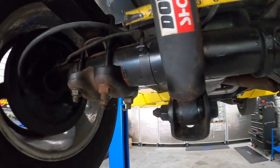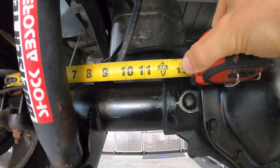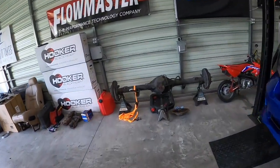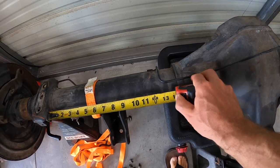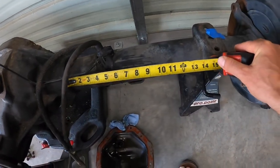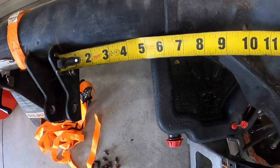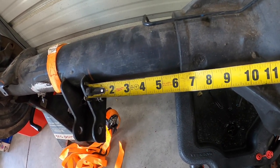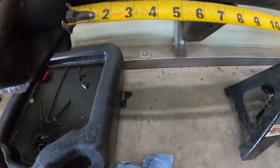From the edge of our perch to the pumpkin it's exactly one foot on both sides. When you go over to the third gen axle it's totally different — we're well over a foot, 14 and a half on both sides. So that's not going to work. Into the perches it's about six and three-sixteenths, which is different, and they're symmetrical on both sides.